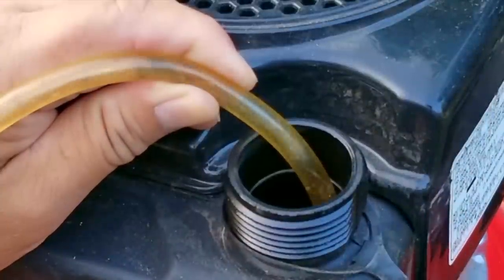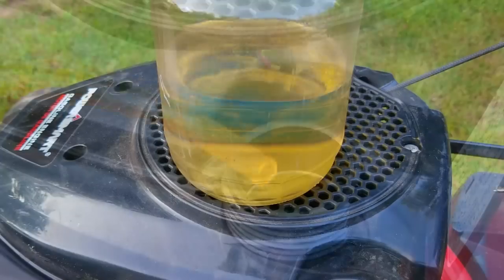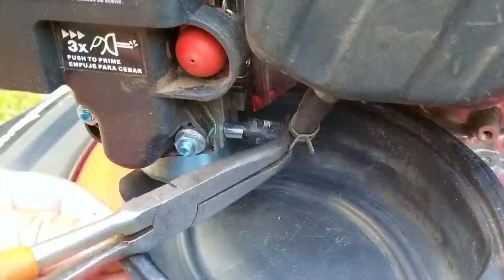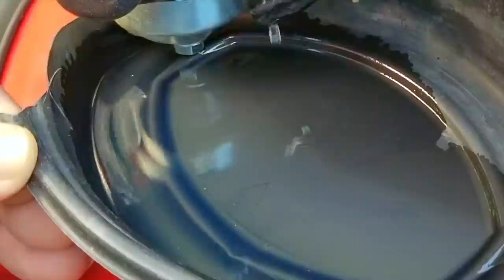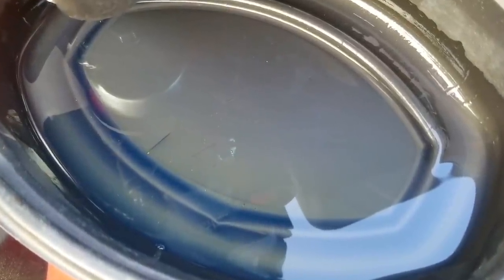With the mower on the table it's much easier to drain the fuel, so that's what we'll start with. The gasoline is not in terrible condition — by the color it seems to be only a few months old so it's still usable. I don't see any water at the bottom of the jar, but if there was any water it would have made its way to the carb, so we'll drain the fuel from there as well. There's still no water here either, so I have a feeling the fuel in the carb will be fine.